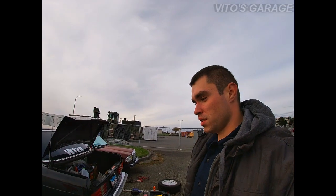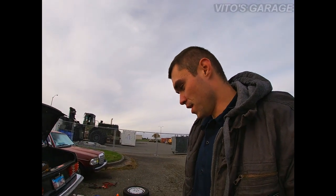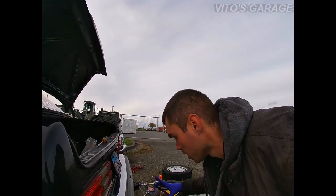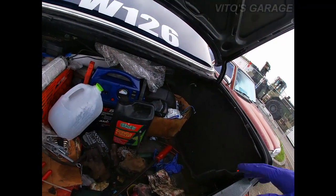This new type of undercoating system is called 'vitalization' — that's what my friend Warren calls it, because I like to undercoat stuff and protect everything. It's pretty simple: you grab wheel bearing grease and some used engine oil, you're gonna need a brush, and then you just start going underneath everywhere. Check these pockets and coat everything.